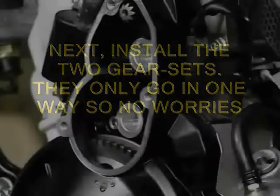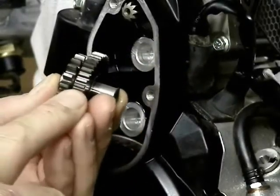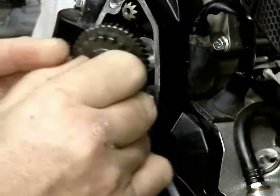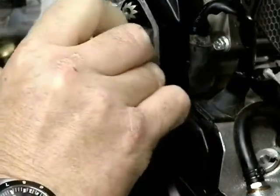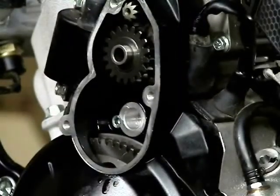Be sure you put some of that grease that you'll see on the starter motor, smear that back around on there or the O-ring and stuff. It'll help you when you're tapping on the flywheel cover. Be sure you get the wires realigned and properly positioned behind there. Remember the fine tooth gears on the top, and it's the one that actually is driven by the starter motor and goes right in there like that. And remember the two chromium shafts are the same length, so they interchange.